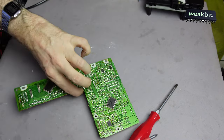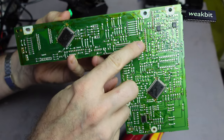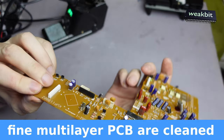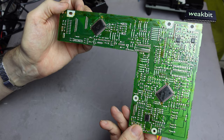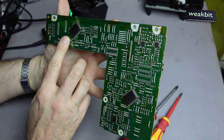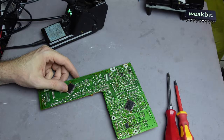Here is the IC we must change, so I'm taking my soldering iron. Plumpik, I show you — you see this brown residue, this is the flux residue. Nothing is cleaned from the industry. All industries are not cleaning their prints. This is a one-sided print — it will be soldered by wave soldering, a wave of solder. The board goes through like this and it's soldered from the industry. There is also no washing. We can clean it, yes, but this is for nerds — the residue has no conductive issue.